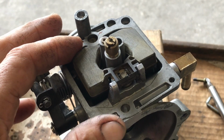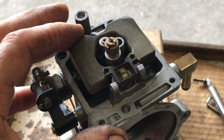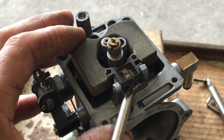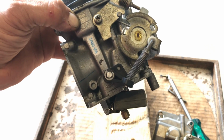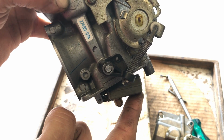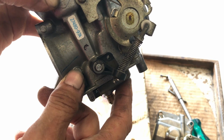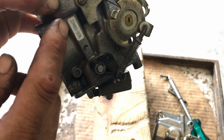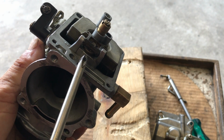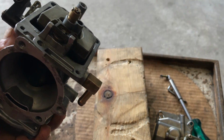The way this works is as the gas fills up, this closes this needle jet right there. Alright, when it's on the bike, gas fills up, this float goes up, and then stops about there, and that shuts the gas off from overflowing and going through that hose. This is the needle jet. I usually clean it once. If that don't work, I replace it the second time.